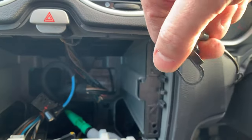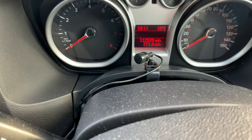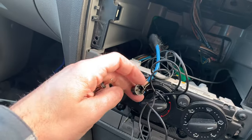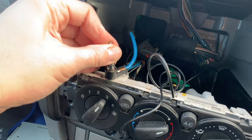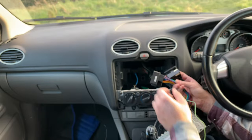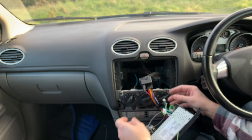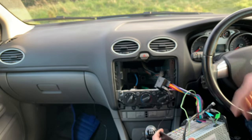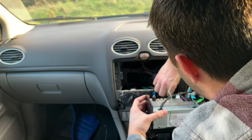As an alternative, you can hook this up to a piece of wire and fish it out from there. But it's done now anyway. I need to put the adapter for the aerial because it needs one. Just making sure everything works — here goes the connection for the Ford loom, which also connects the steering wheel controls, then the aerial connection and the microphone connection.